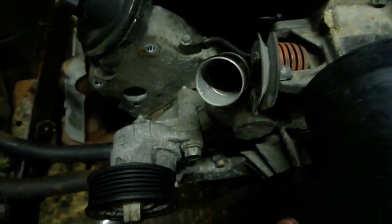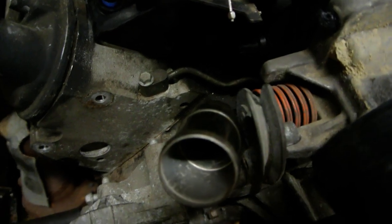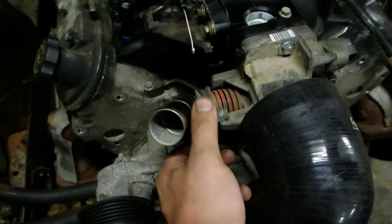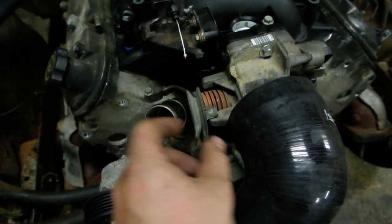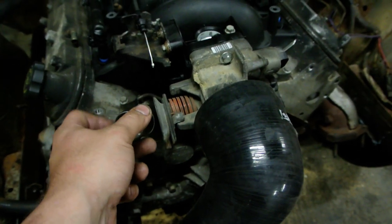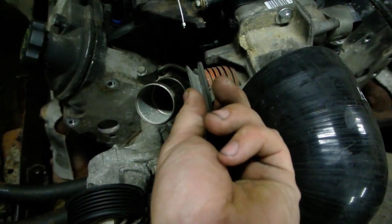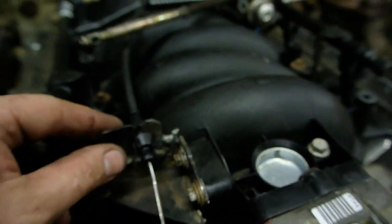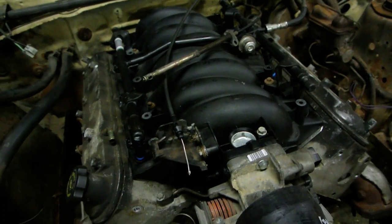What you do is you cut off the cruise control bracket so it doesn't hit, and then you take a ball peen hammer and you just graze the inside of this until it moves clear, and there's no problem there. If this gets too close to your water outlet, which it usually doesn't, it's no problem for me, you can pinch this shut a little bit and then it clears. And I made a nice, look at all my welds in there. Oh yeah, I made this throttle bracket. It's a beast. The intake isn't bolted down, that's why it's a little loose.